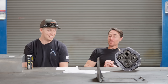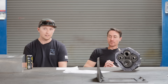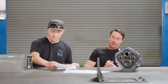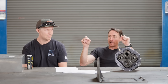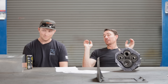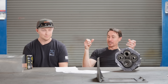Death wobble. The first bullet point is you didn't torque everything properly. Any kind of looseness in the system — especially steering, especially the track bar — can lead to death wobble. Any play in steering joints, even in rubber joints: you might get under there and everything feels tight but if you have a worn rubber joint that allows it to oscillate side to side, that can create a harmonic which leads to death wobble.